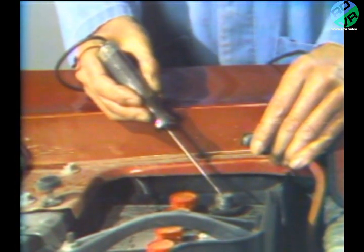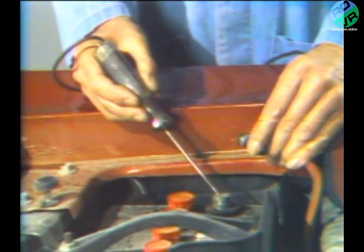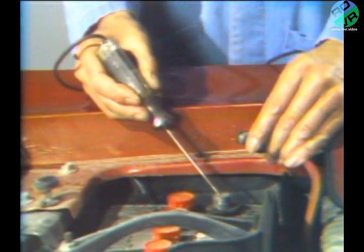The reason we don't use a voltmeter for this test anymore is because the various new solid-state components can draw a few thousandths of an amp. That's enough to show up to 12 volts on a voltmeter, but it's not enough to light this test light. We'll talk about tracking down this kind of power drainage later, but on this car, the test light did not light. The battery isn't being drained by a ground or short.